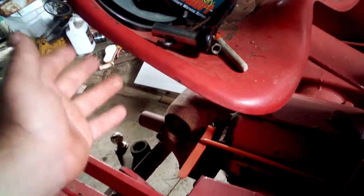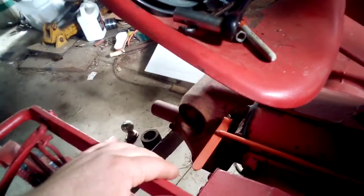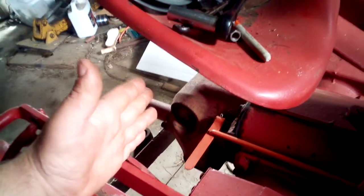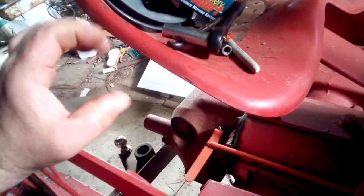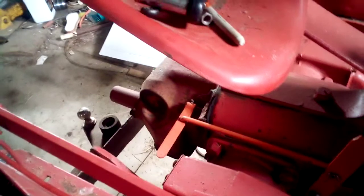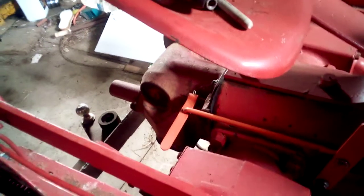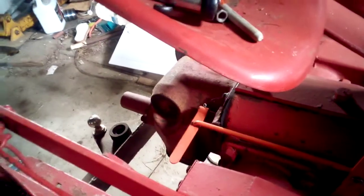So I had to clean all them burrs out and metal and everything. The bearings were all chewed to shit. And I finally got that put back together. I got clips. I couldn't find the solid steel ring ones, so I got the spiral ones instead that come out the same gauge. And it just kind of irritated me though, because it was like $300 for the PTO plus having it delivered. And ready to install is definitely not what it was.